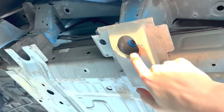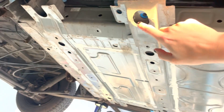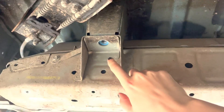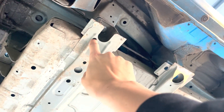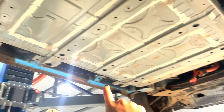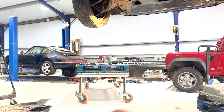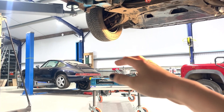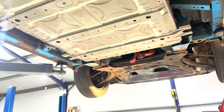There are basically eight bolts holding the pack up to the vehicle. I've removed these middle ones, these rear bolts, and I've cracked off these four bolts, so the pack is now being held up by four bolts. We're going to get the stage deck under the car with the pallet on, get that supporting the battery, undo the remaining bolts, then lift the van up off the battery. That's the plan.